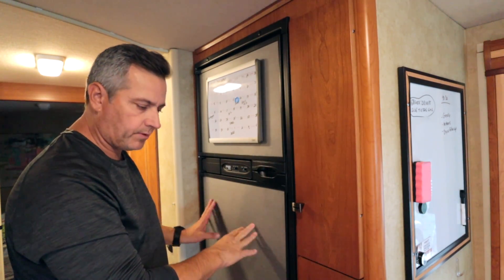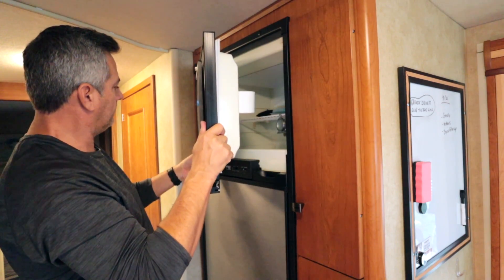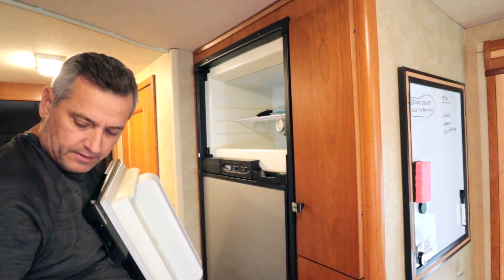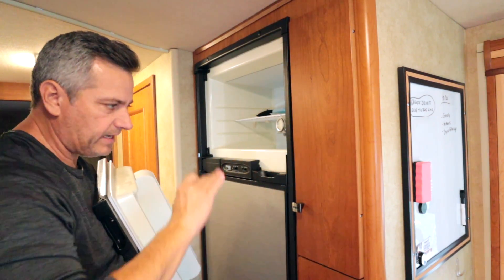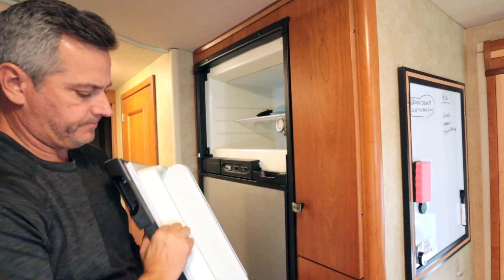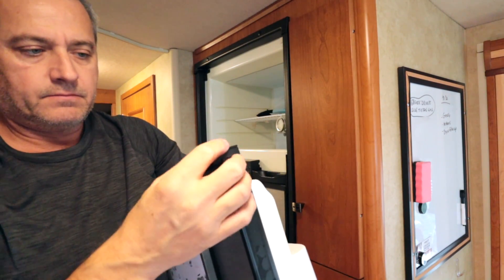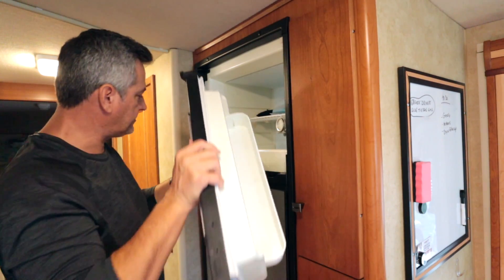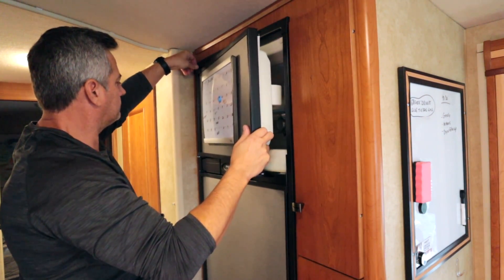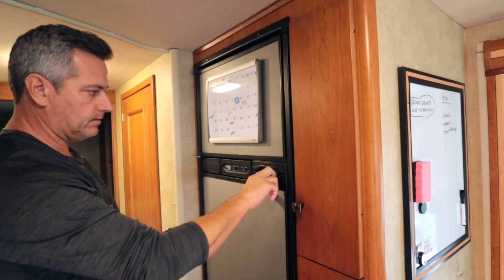For the freezer door it's basically just duplicating that process I did on the bottom door, except I don't have to take the door apart, slide the panel in or out, any of that. Just taking this top screw out, lifting the door out. Here's the stud on the bottom — I had that adjusted a little bit before. Here's the washer that goes on that hinge, and here's the reinforcement plate for the bottom hinge — again just slides into place nicely over that. Pretty simple quick reassembly. And that's it — they open and close like a charm.